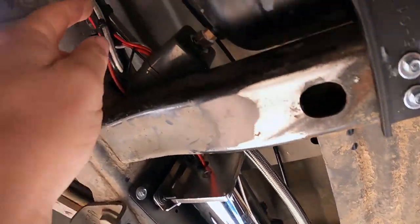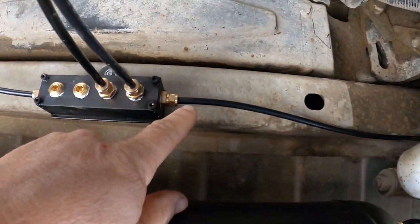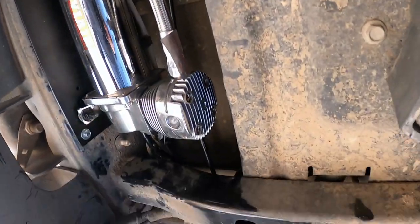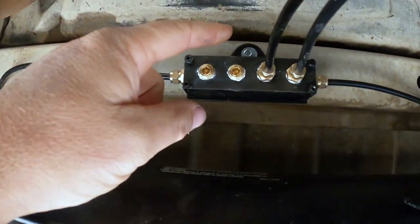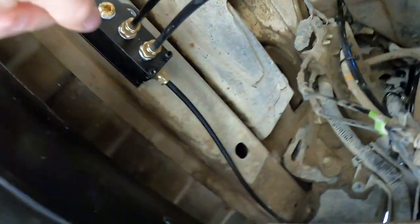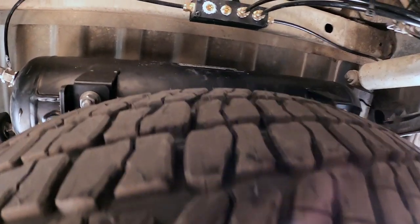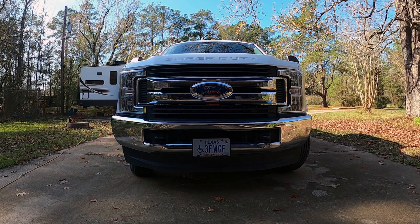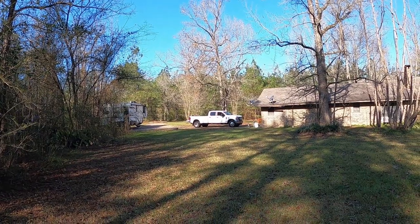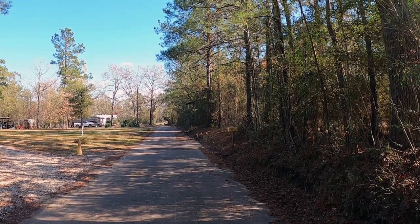We have our air compressor installed and hooked up to our air tank. From the air tank, a supply line leaves and supplies pressure to our manifold. One line leaves the manifold and runs to the rear bumper for our remote air chuck. Another line is the supply pressure to the air horn, and one runs to the cab for the paddle switches for the airbags. When it comes back from the cab, it comes down these lines and airs up the airbags. With the spare tire reinstalled, the air tank is right above it, there's the manifold, and the air compressor is right over here.